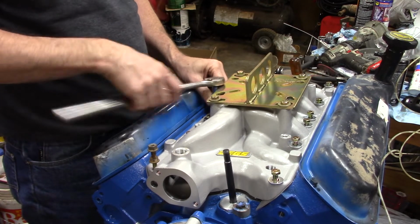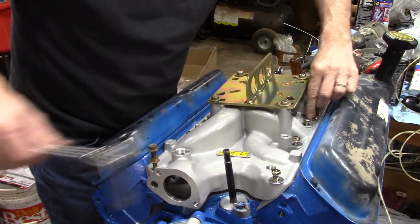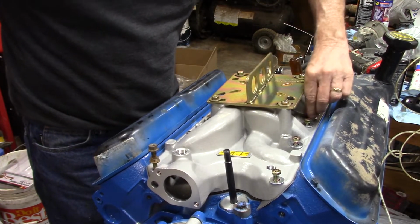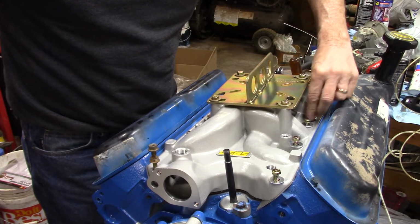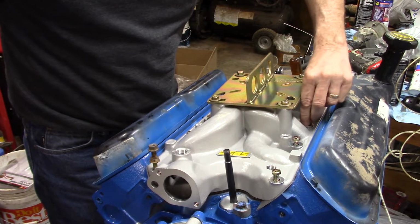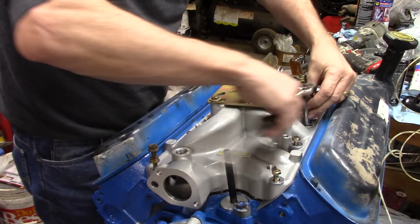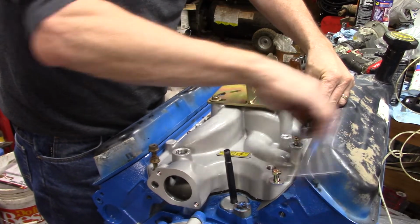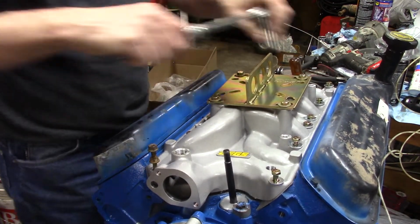So, anyway, I can feel that starting to make noise. And then what I was saying about the carburetor, I bought a reman 600 CFM electric choked Holley. And the reason I did that was because it's easier for startup break-in purposes.